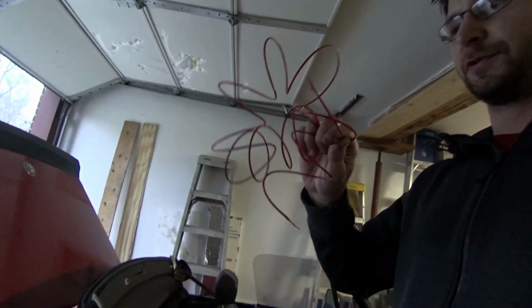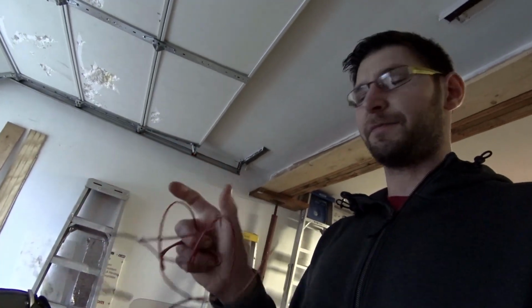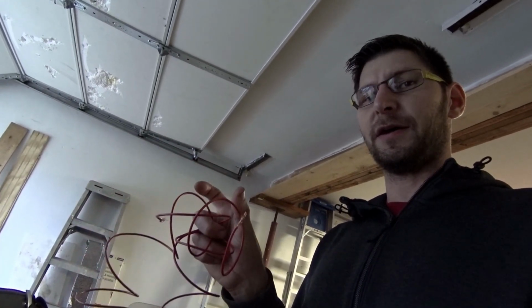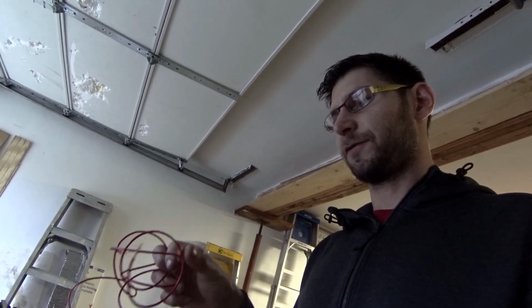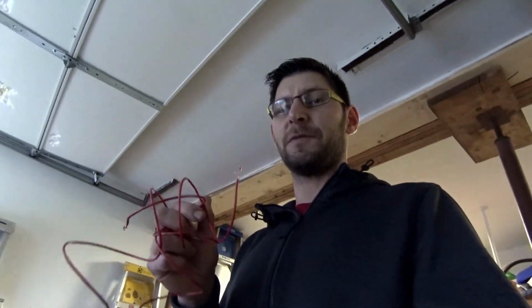So what I did was then take a wire, a really long one, and basically I jumped the big main relay. I took terminal 30 and 86 and jumped power to it. So 30 always has 12.5 volts. 86 does not, that's a temporary power. I jumped it so it would always send 12 volt power to the main fuel pump, which is underneath the car.